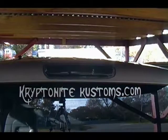Got a problem with the third brake light. The one that is currently installed when I bought the truck is an aftermarket LED one. It has not worked since day one. I've checked the fuse and everything else and it's all good. The dome doesn't work and the third brake light doesn't work. I can only assume that the brake light has failed, being it's aftermarket.